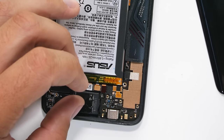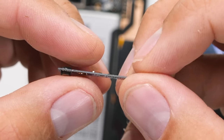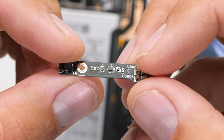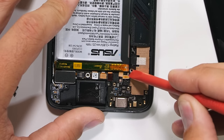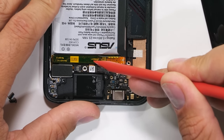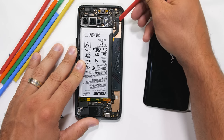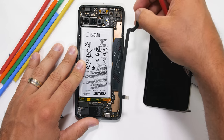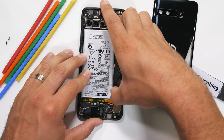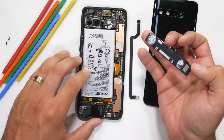There is a strange little raised board sticking out from the motherboard with its own built-in Lego-style connector. It's got four little pins on the back, probably used for communicating with the RGB LEDs on that back glass. I'll start unplugging all the little ribbon cables down by the top of the battery and disconnect all of them to be safe. There is one more long extension ribbon going around the metal heatsink, and then finally we can remove the heatsink itself, held in place by two T4 screws — a little more decorative than Phillips head since the whole thing is visible from the outside.